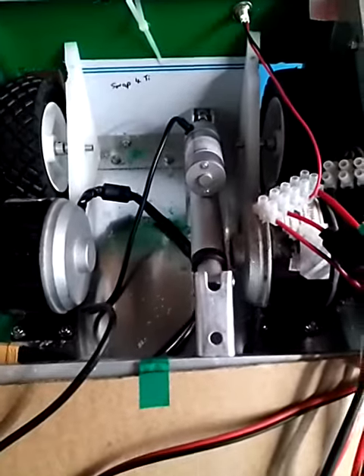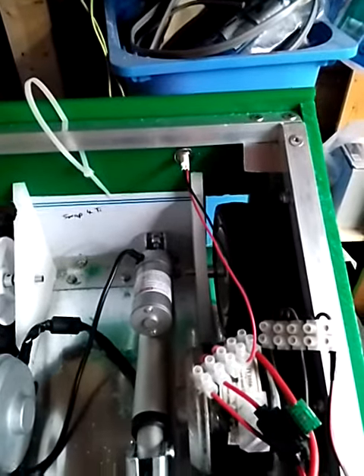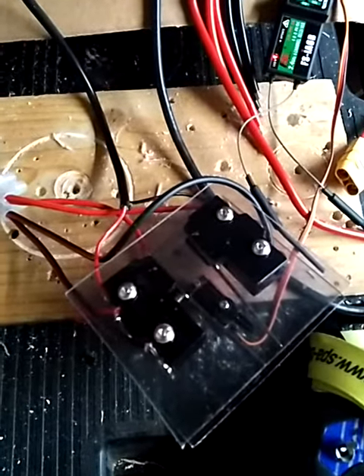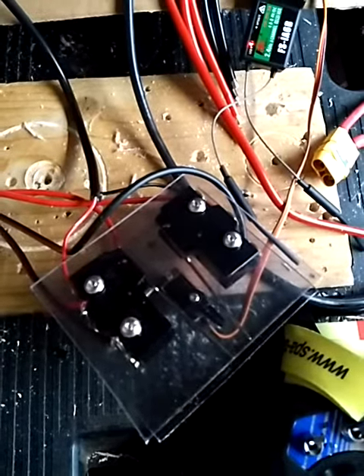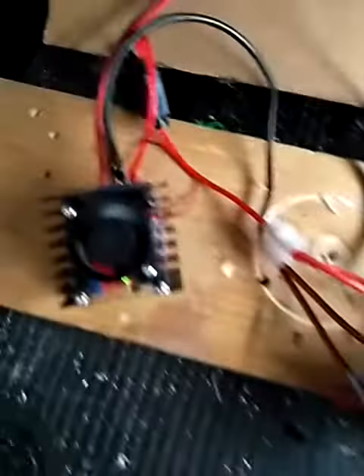At the moment it's got some temporary wiring in place, but I've fused up everything. There's the little safety light at the back, kill switch, S6 battery, 100 amp big fuse at the front. And this is a linear actuator controller with two big 10 amp micro switches.